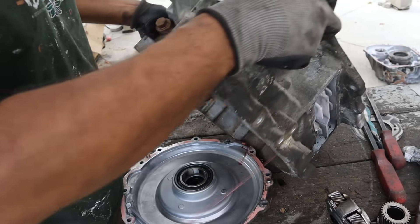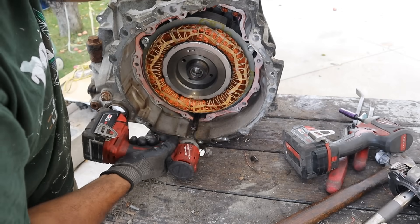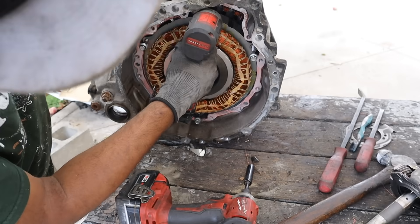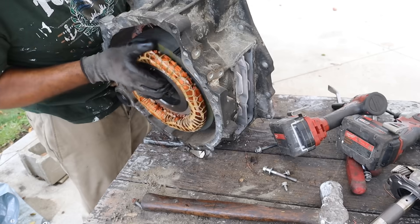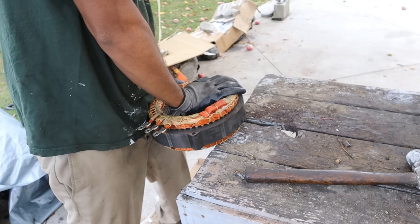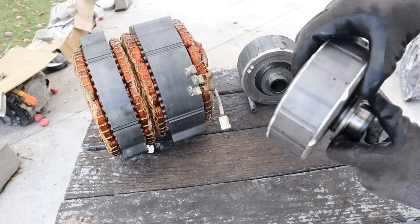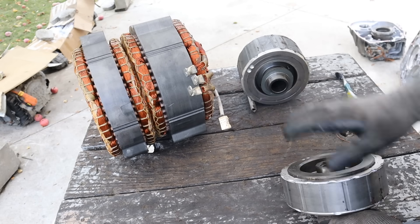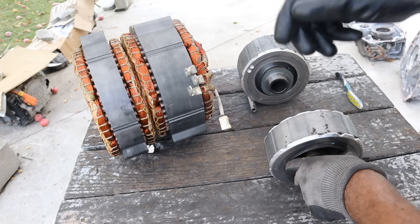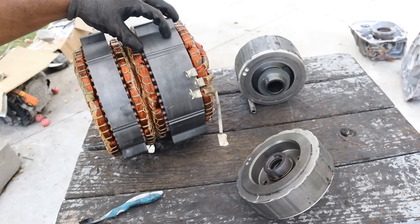The plate has a bearing on it. Inside of here you have some 12s to remove the armature, and a couple of 10s to remove the UV and W phases from the junction block. There's MG1. I'm going to try to remove the rotor on MG1. Here's the rotor for MG1 — it is a little bit smaller and thinner compared to MG2. You've got to keep these away from each other because with the extreme magnetic force, I could probably lose some of my digits.